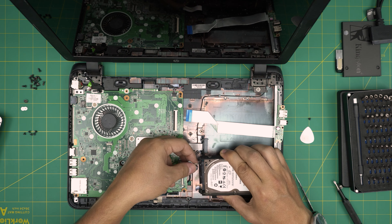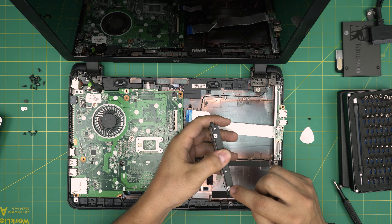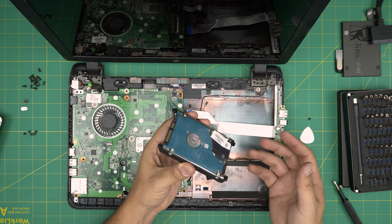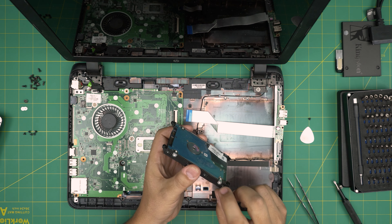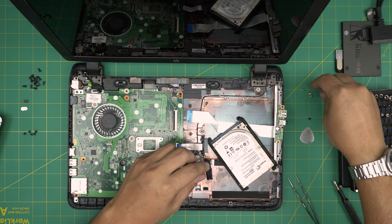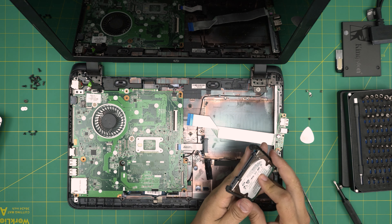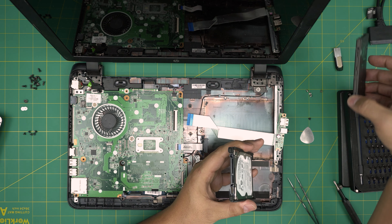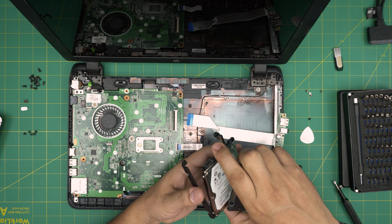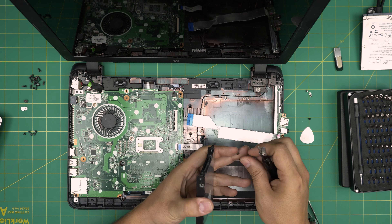When you pull it up, disconnect this cable — don't pull the cable itself, just pull the adapter back. On yours there will be two screws on each side of the caddy, for a total of four. The caddy is just a rubber piece that holds the hard drive in place. Remove the four caddy screws — two on each side. Make sure the orientation of the hard drive is noted: your SSD has to be in the same orientation with the same pin direction. Don't put the SSD in the other way around.